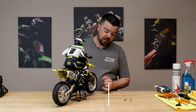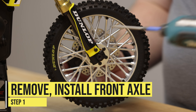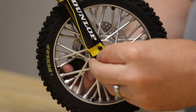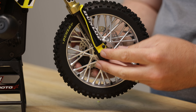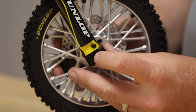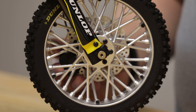Let's go ahead and install these axles. Right here we have the front axle — 2.5 millimeter driver. We'll just run this axle out, and after we unthread it, we pull it out and keep the wheel aligned. We'll grab the titanium axle and basically run it in and through, getting all the alignment through until it's in the other side.